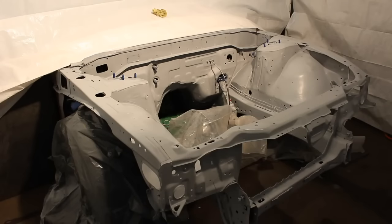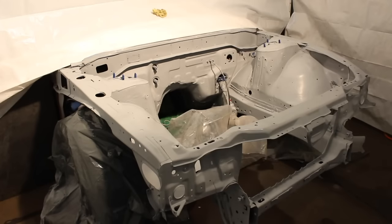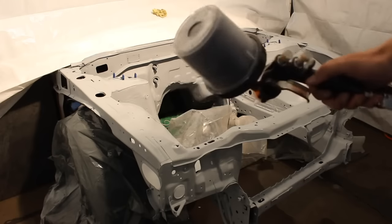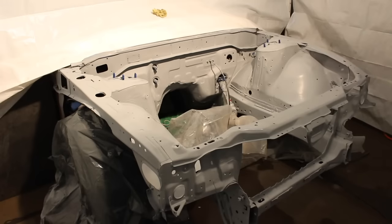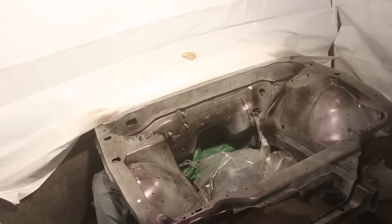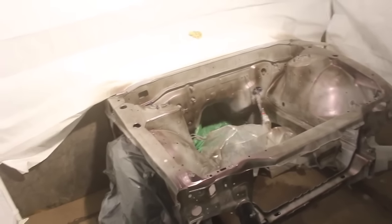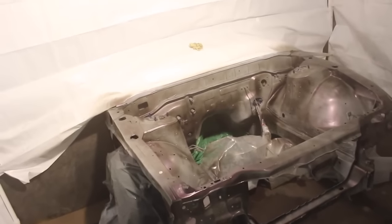Alright guys, I'm just going to go ahead and adjust my fan and all that good stuff right here. I'm going to go ahead and just test it out on the side piece of tarp, just so I have exactly what I want as far as settings go with the gun. With metallics, just want to make sure you give it a quick little mix around in there if it's been sitting for a while, because all those little particles will kind of drop to the bottom. The first coat is done — a real light dusting. Once we have this coat down, this is basically just something to grip to for the next coat, so you want to apply it a little bit more wet.